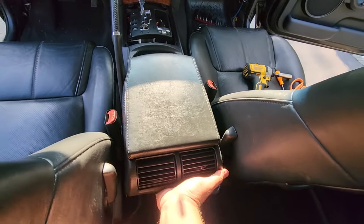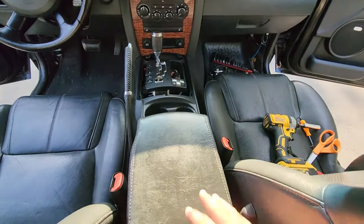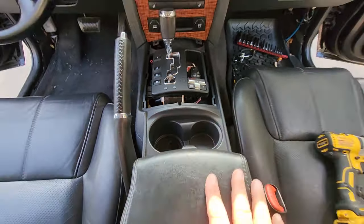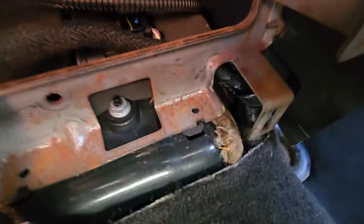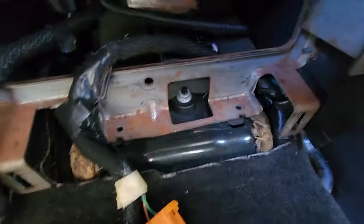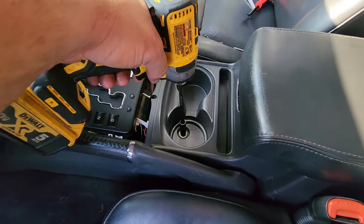There. When it's in, you can give it a nice shove forward. So the two plugs go into where they are. You're gonna wanna line up that 10 millimeter hole to where the bolt goes. And it should lay down pretty close to where these screws go. And we could adjust them to get this lined up with the hole. And when you're pushing, make sure you don't push your vents in. All right, I'm just gonna send in my 10 millimeter.